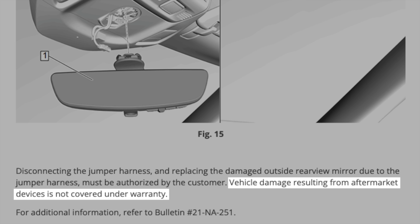If you take a look at the mirror tap, one end plugs into the radar detector and the other end plugs into the back of your powered rear view mirror. There are two pins — the red one is for power and the black one is for ground. The trick is when you go to plug in your mirror tap, you take the red power cable and plug it into the red wire in the wiring harness of your Corvette. Then you take the mirror tap's black ground cable and plug it into the black wire coming out of the back of the rear view mirror. The issue seems to arise if you take the black cable for your mirror tap's ground wire and plug it into the gray wire in your Corvette. So for C8s, just run the red cable into the red wire and the black cable into the black wire — don't plug it into the gray cable, otherwise you're going to run into the voltage issues that GM mentioned in their TSB.